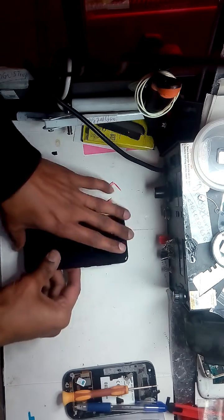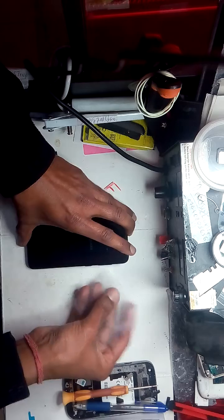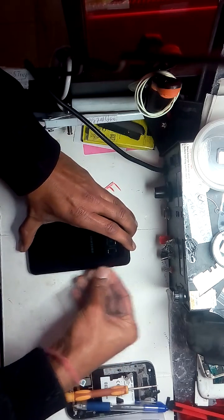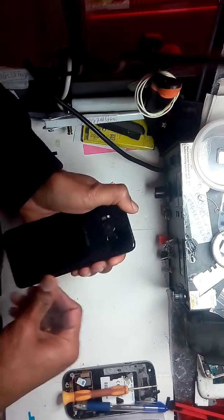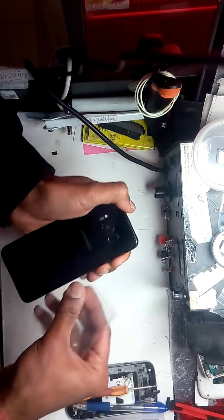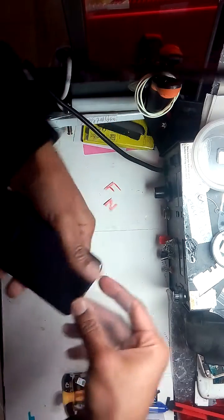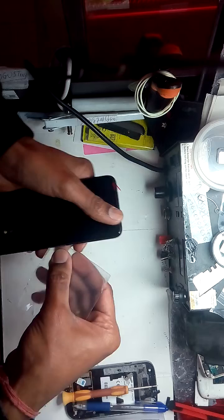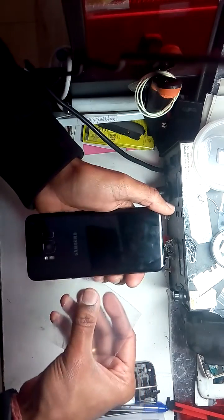What to do: you just open the back. Use this kind of thin plastic tool so you can remove the glue from the corner. Just watch out for the Touch ID flex on the back.